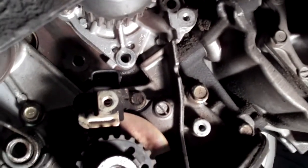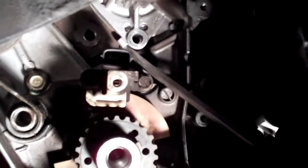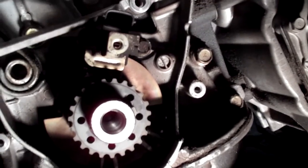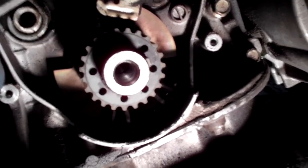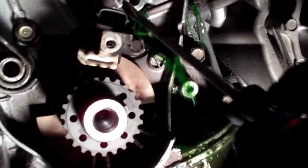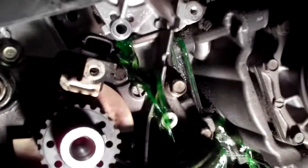We're going to go underneath. So you go up underneath here, and there's the water pump — the old one that's in the car — and you can see this little tab right there. These tabs are to enable you to pry the water pump back and get it to pop out. Basically, you get underneath that little tab and pry it up. That way you're prying on a non-critical surface. If you were to put pressure somewhere else between the water pump and the mating surface, it would cause problems and you might have a leak there. So that's what the tabs are for.